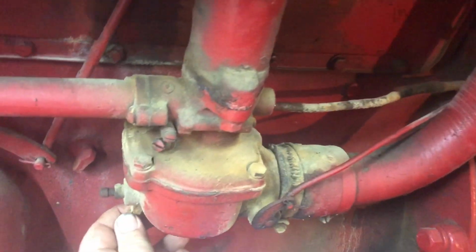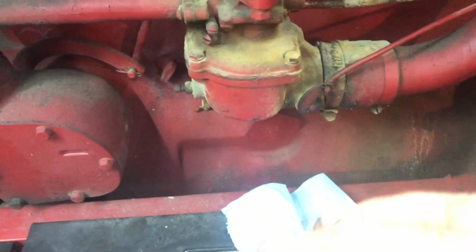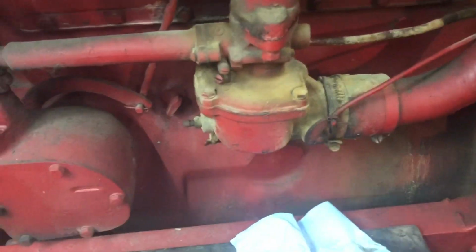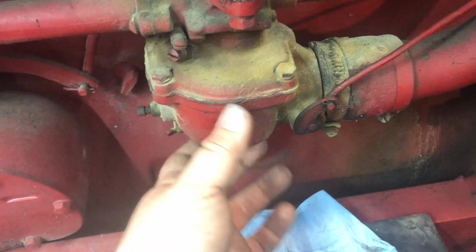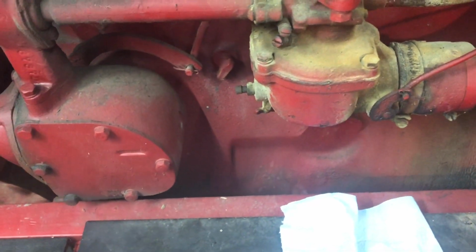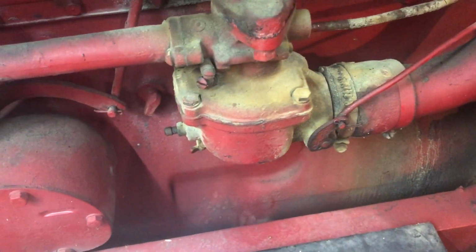It's got to be in the carb, because you can narrow it down, there's nothing else it could be, in my opinion, because of how it's running. I think you have to have the choke all the way on, which tells me a jet is probably clogged, some kind of debris in there. Without pulling it off, this is just my shotgun in the dark idea, that something inside there is plugged up, and so when you put the choke on, instead of letting all this fresh air in, it has to really suck in the air. There's a little hole in the bottom, basically a bypass, and because it's pulling so much harder, my thought is it'll help pull the fuel. Basically, it'll create a bigger vacuum in here and help pull the fuel through. It's the same way as when you're trying to start it cold with the choke on, it helps enrich it. So the fact that it only runs with the choke on means that it's pretty lean.